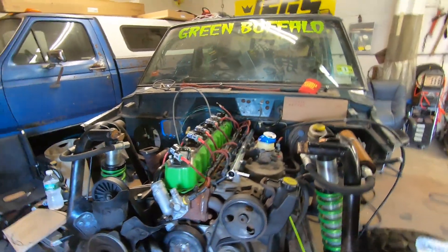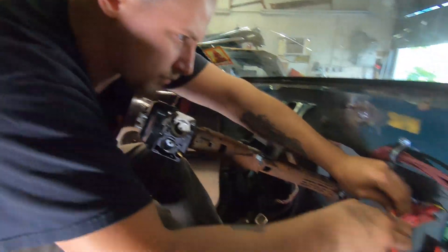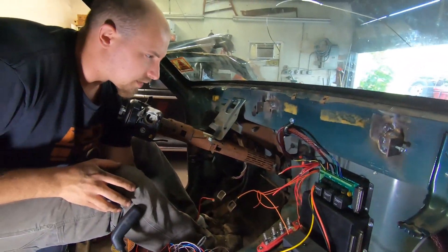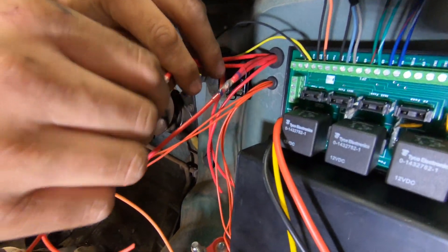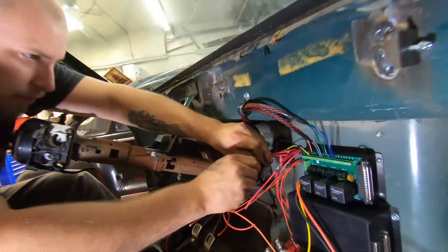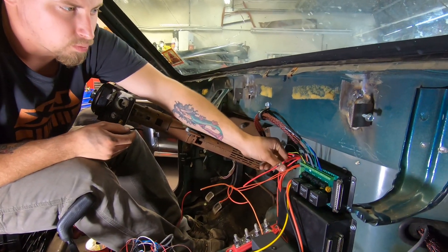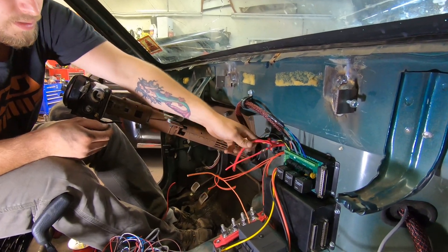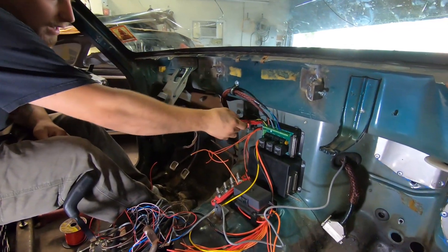The only things I still have to run in the engine bay are the cam sensor and the crank sensor. We'll also be splicing in the injector wires to switch power off the relay box — there are only four slots, so we're going to splice two together into one, and the other two will go in directly, using all four slots. I just used a little thicker wire than I should have for that section; for the rest we went down to 20 gauge. That's really the only mistake I made and we're making up for it.